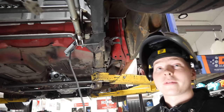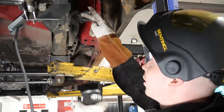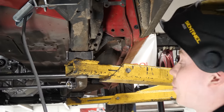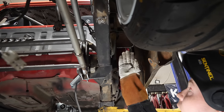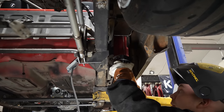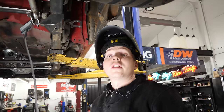The way we ran the fuel lines last time is kinda how we're gonna do it. They're gonna come off the tank, they're gonna go into this filter, and then right down the outside of the frame. So it's all nice and right there. I'll build a little shield coming off of the bed that shields this from wheel well debris, because, you know, don't want another Eclipse.